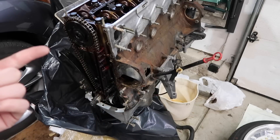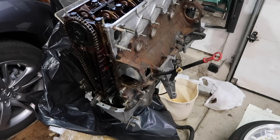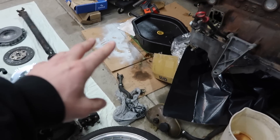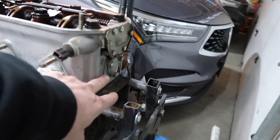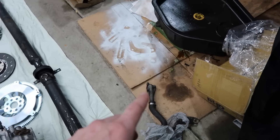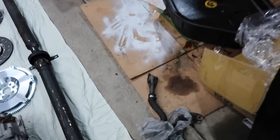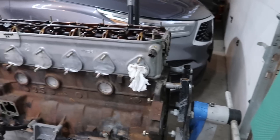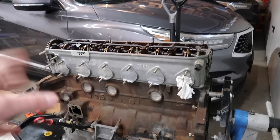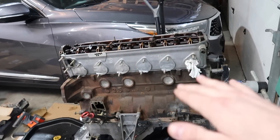You've got to worry about the engine mount arms and the oil pan, and then the rest will be the engine electronics. One more thing that will have to be swapped over — and hopefully you have an M30B32 or a B34 to get this from — is the water neck. The back of B35s do not use the water neck hole; they close it off. But E28 connections will want this, as it goes into things like the heater valve. I believe the stock 528E heater valve will work. This neck will take the place of that cover, and then you have the coolant hoses routed how they want to be routed. I think you want 535 E28-specific coolant hoses — something I won't know until I get it in.